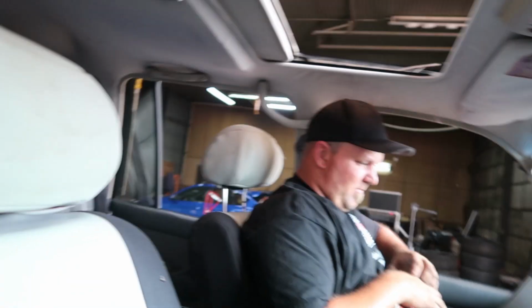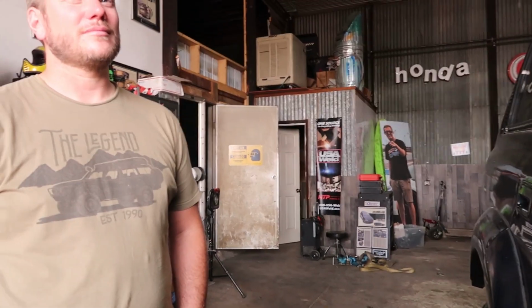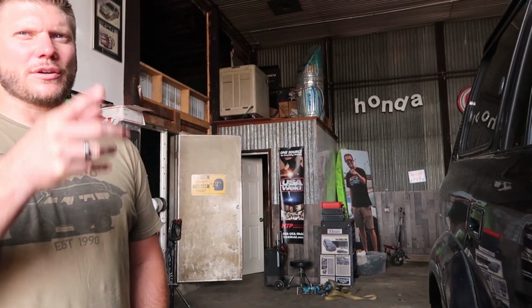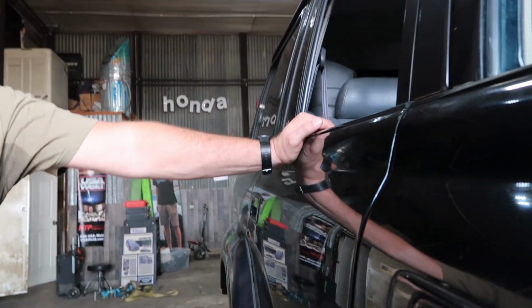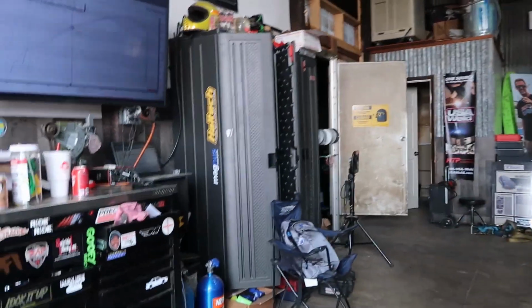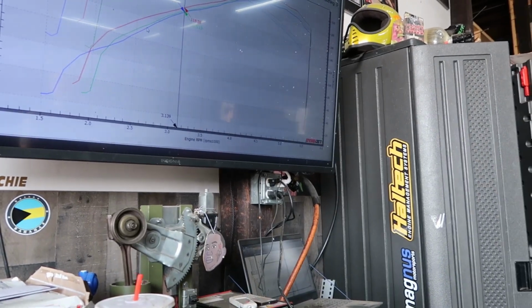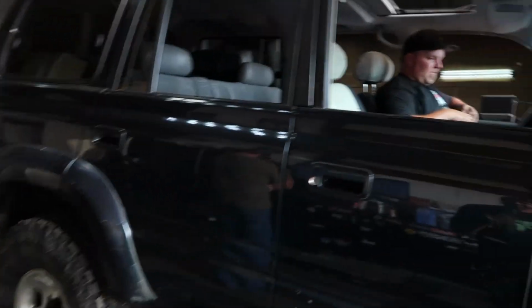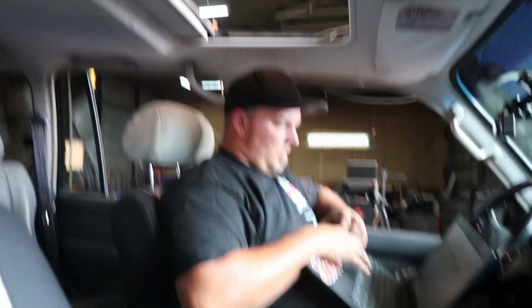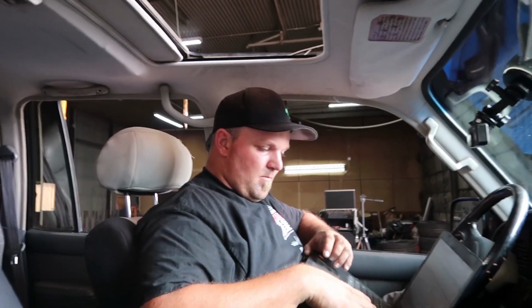You know, it could be the exhaust leak off that bank. The exhaust leak off that bank could be giving a little bit of a false reading because it might not be getting the whole reading. You agree there seems to be an exhaust leak? Oh yeah, for sure. That's where he could be getting the weird O2 readings. Well, that'll be the next step before we even attempt emissions. Let them go in and patch up their welds. Yeah, for sure. And even the cats, you could smell them that time too.